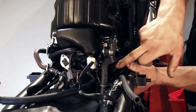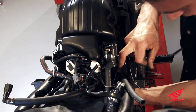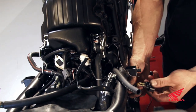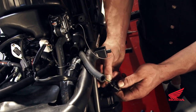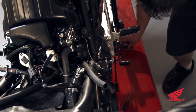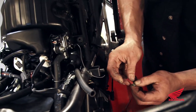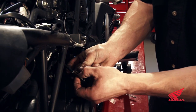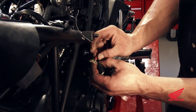Makes it easier to see. Go ahead and unplug it — it unplugs from underneath, it's a five-wire plug. We're going to tap into the solid yellow wire to the DynoJet box. Grab the PosiTap that DynoJet supplies, unscrew the gray piece, thread it in behind the yellow one, and screw the red connector back on.